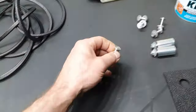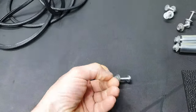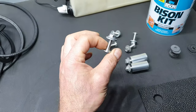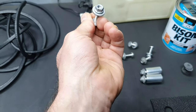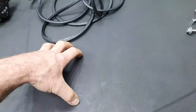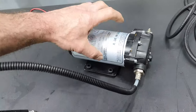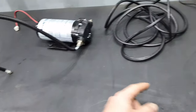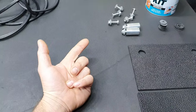All right, then I made some threads. I'm going to show you later with the threads. Yes, these studs are supposed to be welded from underneath the plate, so you're able to see only the threads, nothing more, nothing less. And there are two for the two brackets, for the two units over there, and also 4 pieces for the methanol pump that is going to be M6, not M5. It's supposed to come with M5, but M6 has a tighter fit, and it's much stronger if you like.